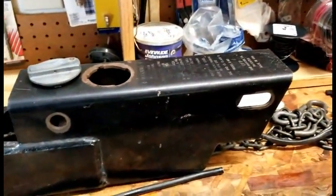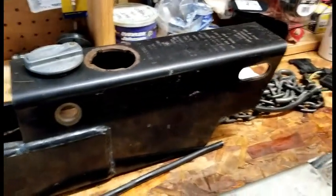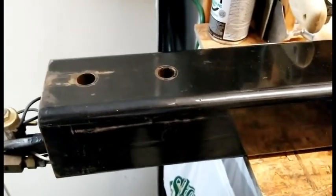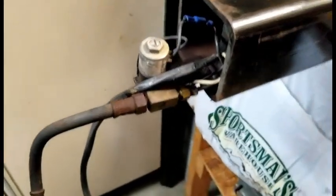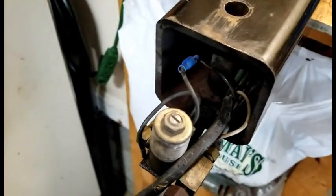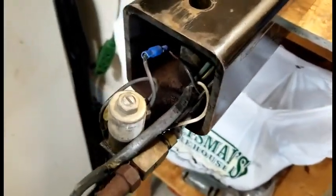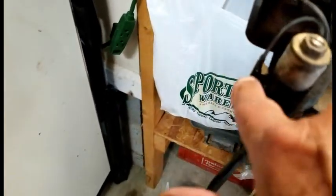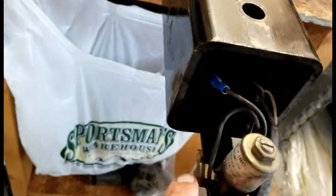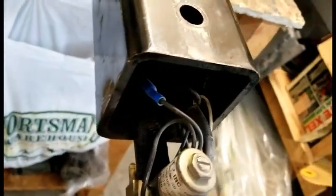My actuator can be removed from the Ranger trailer. There's the actuator itself and then there's this long pipe that runs the length of it. These two pins go into the trailer so that the whole unit is supported there. On the back end of this unit, this is for the reverse. When you go to back up, you connect your backup lights to the plug. When you put it in reverse, this actuates. There's a tube that runs from here all the way up the length and connects into the back of the actuator itself — it just plugs in and is held on with a tie wrap.